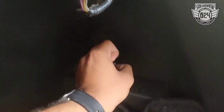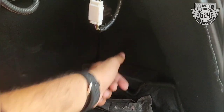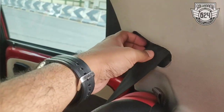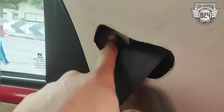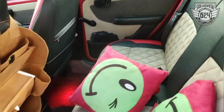The same thing applies to the right side — the inertia reel is located inside this panel, you cannot remove or see it. To fit it, the body shell had to be cut slightly. This has been done on both sides. You can basically see the body shell on the inside — this is the body in white — and that is how the three-point seat belts are fitted onto the rear seats.